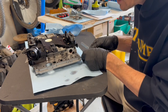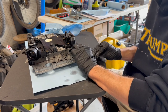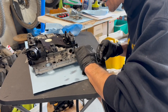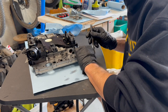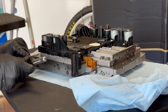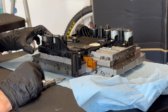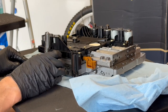I'm drilling a 56 today with a brand new OEM Mercedes-Benz converter because I'm willing to give up like a mile per gallon of fuel economy for a much looser-feeling transmission that lights the turbo up quicker with way less lag — because the converter doesn't have to unlock to get the RPMs high enough. This is the torque converter lockup circuit right here. This is the plate we're going to drill a hole in, so that the commanded signal that goes to here — the reference signal that moves a piston that allows high pressure to the lockup circuit — is bled slightly.